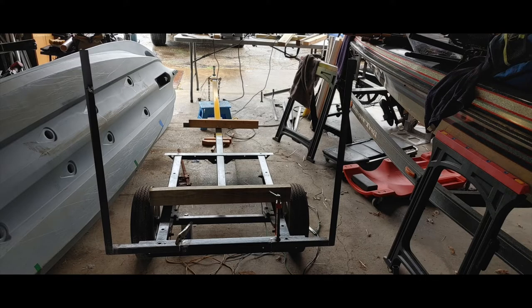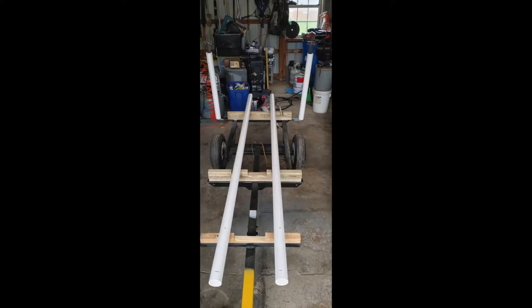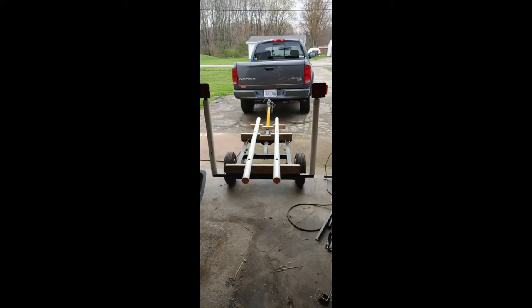Here from the rear, I have welded two uprights on either side of the frame to mount the trailer lights up high and also as a guide when I'm bringing the kayak in in current or wind conditions. Here I've got the little T-bracket on top to mount the light, and before I welded that on I slid PVC over both of the uprights just for a little cushioning. Here we've got the PVC rails ready to be mounted to the wood frames, and here they are mounted — you can see it from a rear view. Simply drilled a one-inch hole in the top of the PVC and a smaller hole for the lag bolts that go down into the wood. Holds it really well.